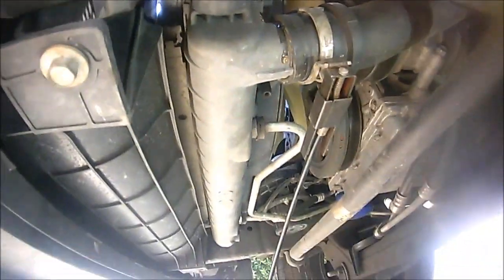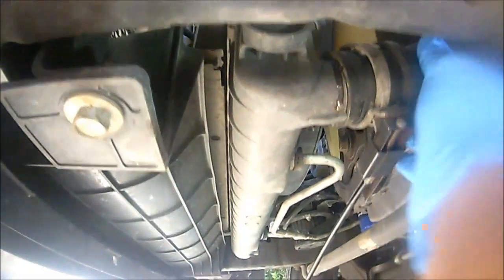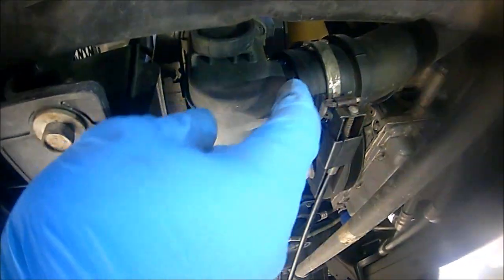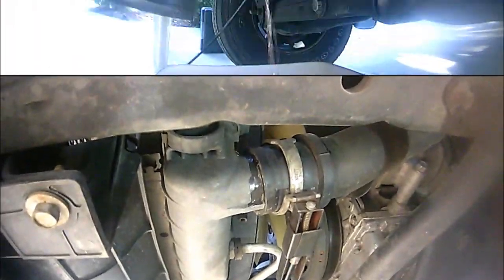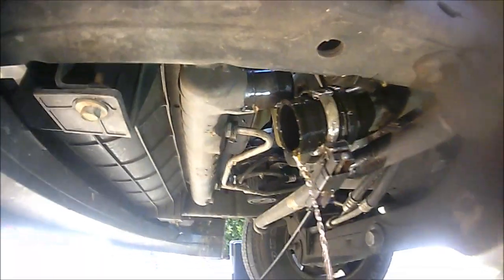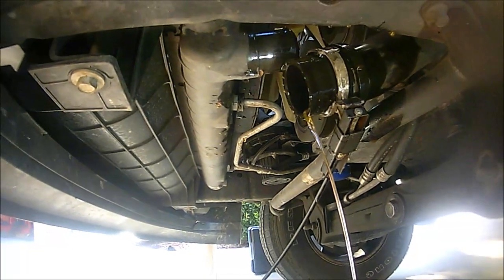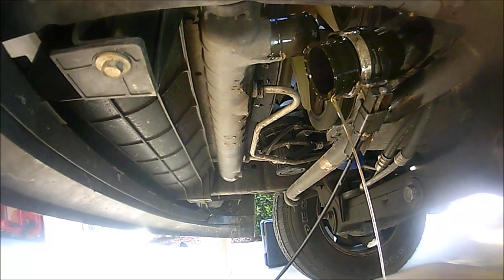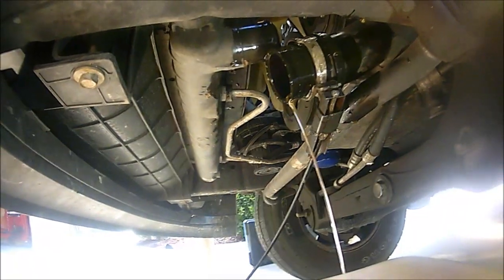the radiator hose. Just be careful not to get coolant in your eyes. And again, if this doesn't come out, you could just put a screwdriver in between and just wiggle it out. So let me go ahead and remove this with two hands, and then we'll come back. And this is what it looks like once you remove the lower radiator hose. It's already draining into my bucket here. Just make sure you use safe precautions and wear some gloves, because this coolant is very poisonous, not just to humans but to animals. Alright, so let's go ahead and continue with the next step.